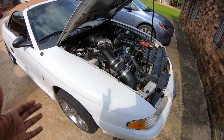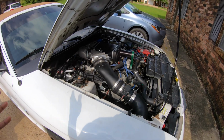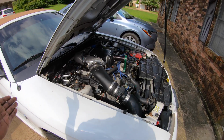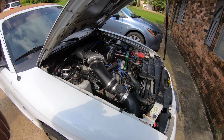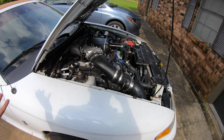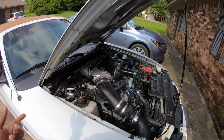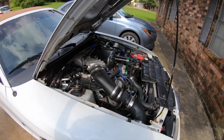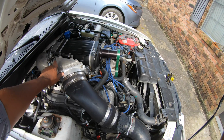As you can hear, even here, it's in closed loop. So we're running about a 14.1 to 14.7 E10, E0 stoic value. Granted that this is on E85, I do still use the gasoline AFR scale for simplicity of the tuning, the programming, and everything else. The other format that you can do that in is Lambda. So you can hear here, bam.